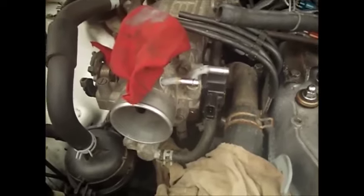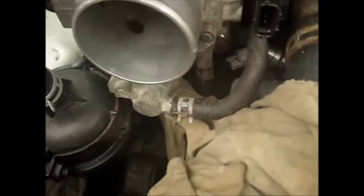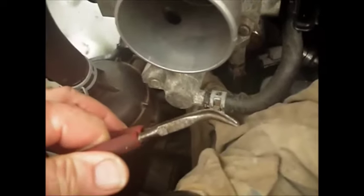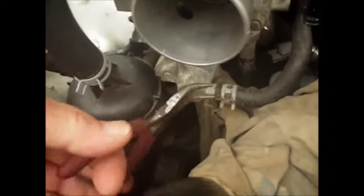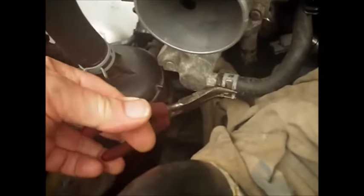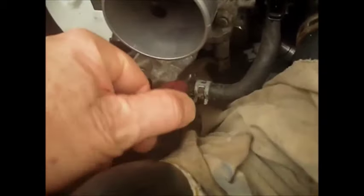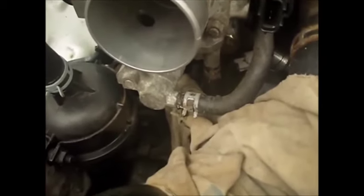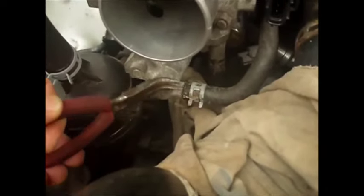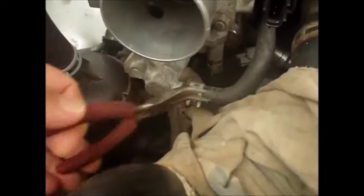So now I'm going to take off some more. When I take off these type of fittings, I usually use these little bent nose pliers, because then you can get a hold of all three of the fittings at one time and slide them along. These in here, sometimes it's easier if you have a larger pair of vice grips or something with a big flat area, because you have to grip all three of these prongs at the same time in order to move them.